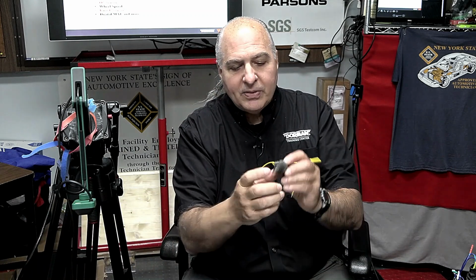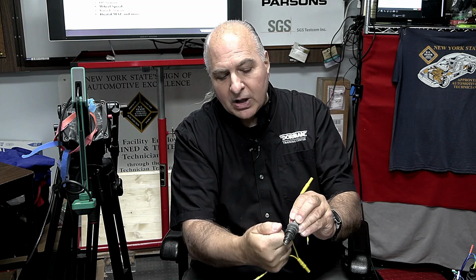If we had to open that pintle up and we have high fuel pressure behind it, or we have a low resistance injector that we want to move real quick, we're going to have to use a lot of current. Once it's open, the whole circuit uses very little current to keep it open. Does that make sense to everyone?